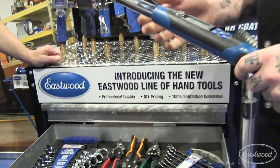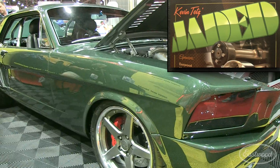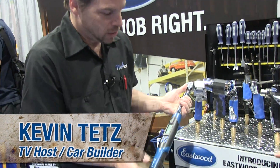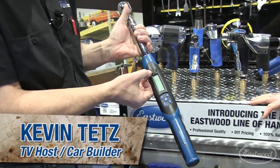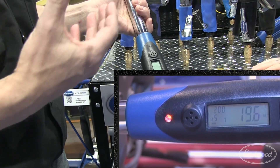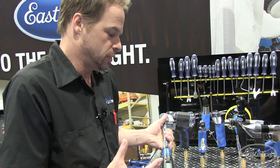We're talking about precision — building a car like this, everything's a really tight fit and high performance. The great thing about a digital torque wrench is you've got the audible tone, and you've got a light that's going to come on and flash a different color when you get close to your torque spec. It's so important with torqued bolts and mechanical fasteners that really need precision.